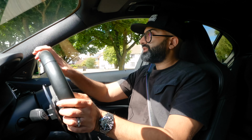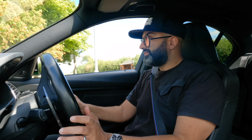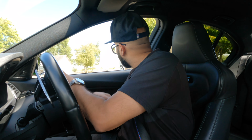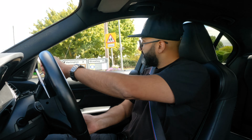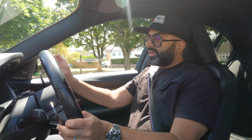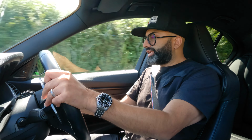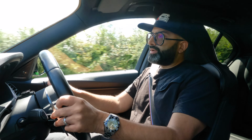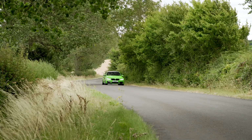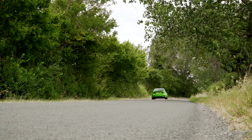So that was that stretch of road in comfort. It's still very comfortable, compliant, it handles the undulations really well. The sport setting we have made the same as Bilstein's own B6, so because the comfort setting is softer, you get more of a change going to this mode. So again, it's still handling the bumps pretty well, but it just feels a little bit sharper.